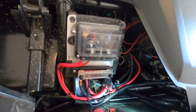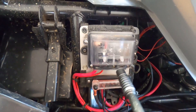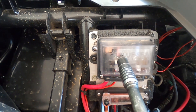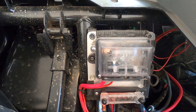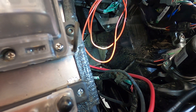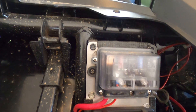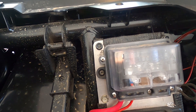I installed my own power distribution panel. As of right now, I've got four fuse holes in there. This first fuse is carrying the front light bar and the two light bar switches. When I wired in that second roof light bar, that red wire hanging down right there is actually the trigger wire for a relay for the roof bar. It'll be super easy to install when I do it. I included this power distribution panel along with this little ground bus bar.